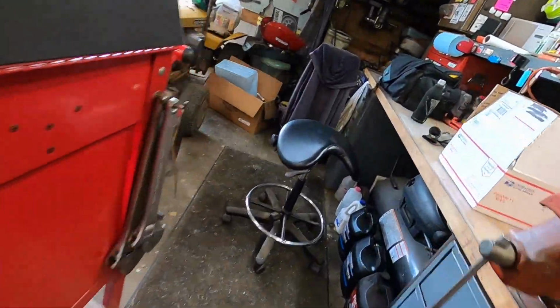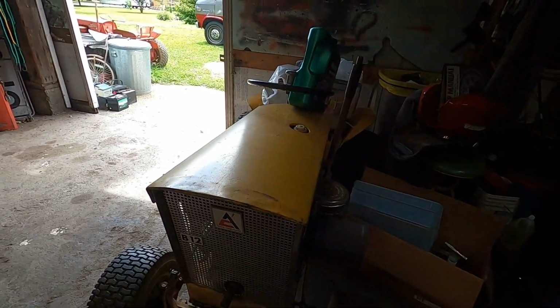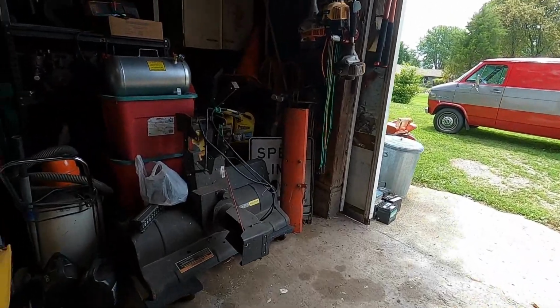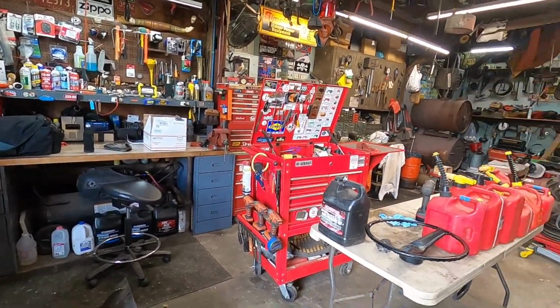we will have a kind of a different repair coming up next week that I think at least some of you are going to enjoy. I don't work on cars for the most part, unless they're my own. But my decal guy has the 1962 Chevy Bel Air, four-door, beautiful car. It is not getting oil. They're hydraulic, so it just has fixed rockers. It's not getting any oil to the front four rockers. You've got the perch that mounts to the head. The oil comes up through it. Oil's not coming up through it. It does not look good at all.